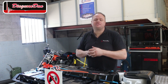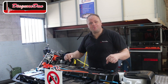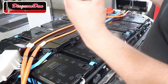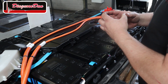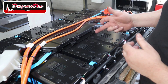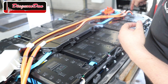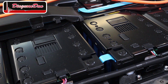We have just learned that by adding cells we can create a higher voltage. Now exactly the same thing is done in high voltage batteries. A high voltage battery is made up of individual battery modules placed in series. This particular Outlander PHEV high voltage battery has got a total of ten individual battery modules placed in series. Here you can see how it's done in a real high voltage battery.